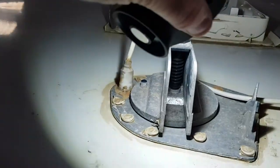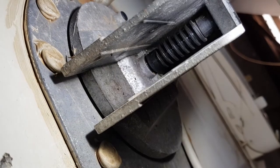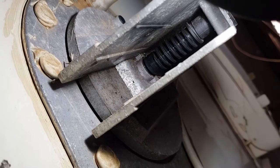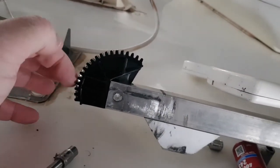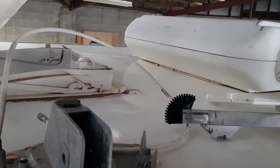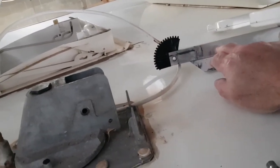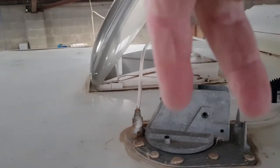We'll put a bit of light in there and you'll see the little worm gear inside that just spins around. Have a look at the teeth - the teeth on that are pretty good, worn a little bit but fairly even, no chunks out of it, spinning quite freely. At the end of the antenna arm is the corresponding gear that meshes into that, and as this one spins, this one just tilts the thing up. It's a pretty simple system, though it's a relic of the old bladed wind guard which actually had two bars - one in the bottom and one in the top - which was a lot sturdier.